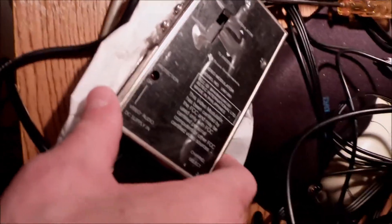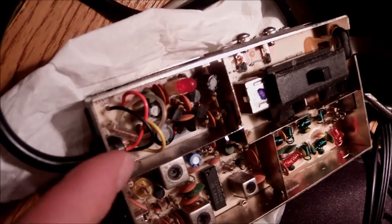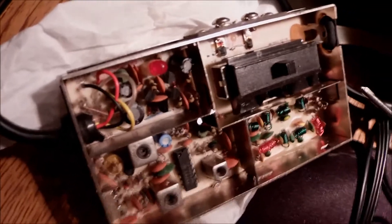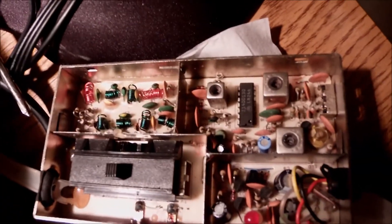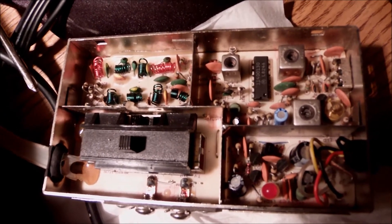All I have to do is open up the RF modulator and see where the cable comes in, then cut the cables from there — just to know which color was where. None of these compartments is useful to me anymore since I'm going to connect the computer to the AV sockets. I'm going to cut these off, make use of the cable connected at the back of the computer, and then according to the diagram put RCA jacks on and connect it to my TV.